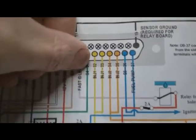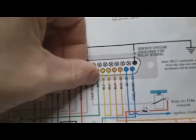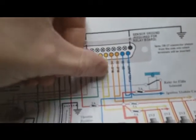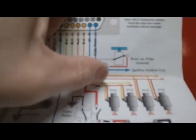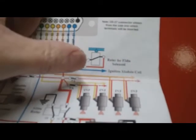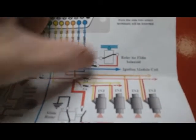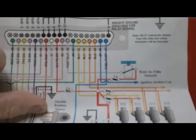Also, I see injector one and injector two outputs — I don't understand why there are two outputs that are then joined together. And how does batch firing work on an LS? Is it left bank and right bank, or is it crisscross? I saw an illustration somewhere showing it fires in an awkward order. How do those hook up for the injectors?